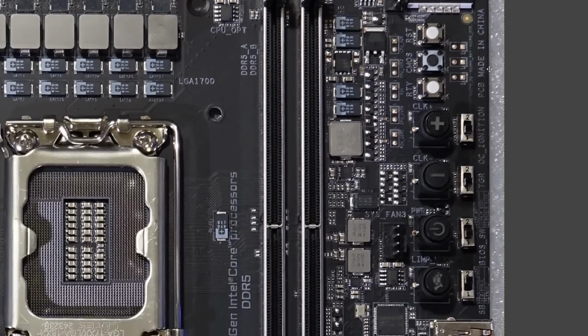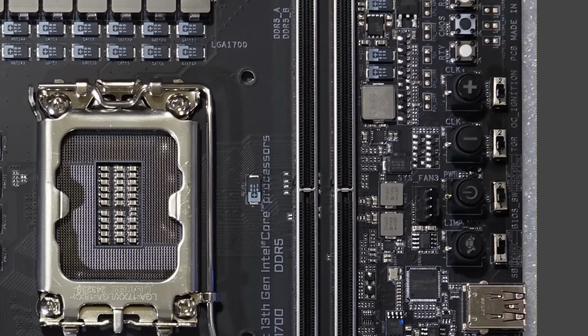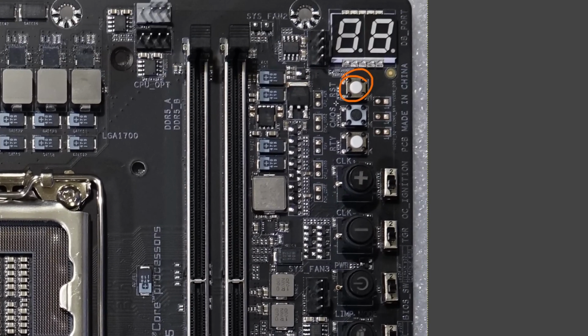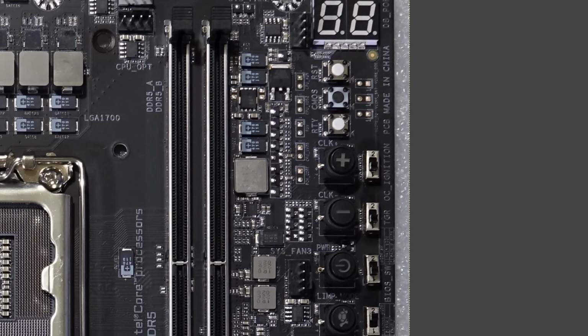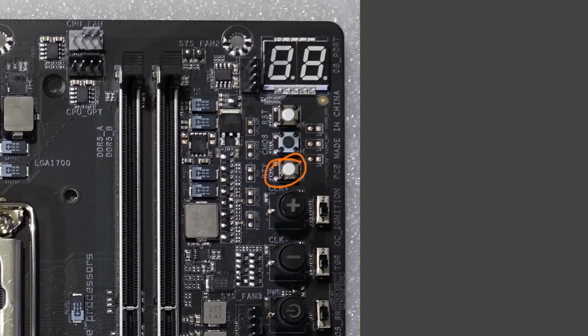So, funny thing with Intel CPUs, and I think you can also manage this with Ryzen chips, but it's far more difficult to do. But with Intel CPUs, it's quite easy to crash the CPU so hard that the reset button stops working. The retry button always works, because the retry button isn't your usual reset procedure. No, this button basically just disconnects the motherboard from the power supply, because it disconnects it on the motherboard and not on the power supply end. It doesn't tell the power supply to disconnect, it cuts the power from the motherboard side. So this is a really hard reset.